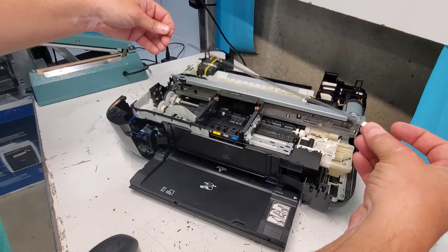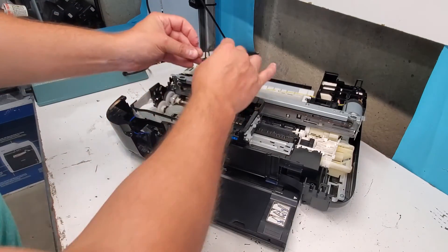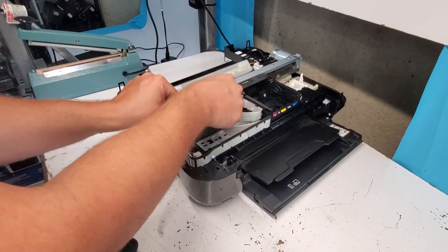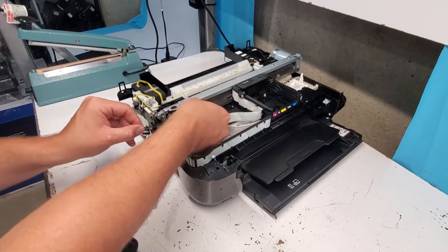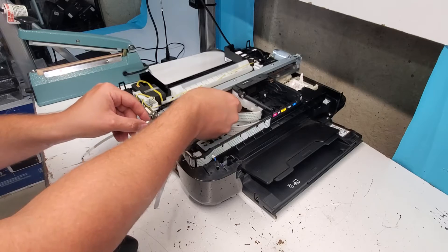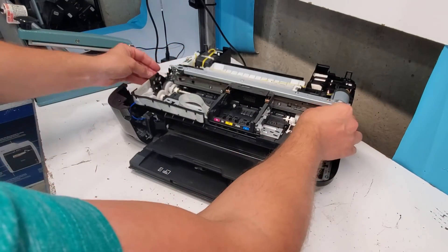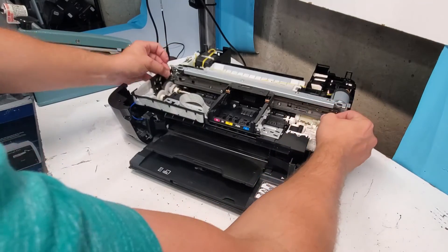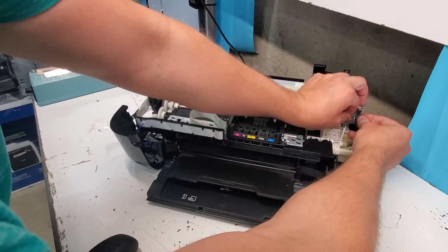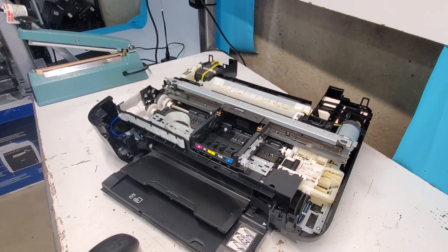The timing strip goes in here. Install it with the digits facing the side you can read from. You're going to feed it through first — it's probably best to feed it through before you fully install the carrier, so you can make sure it's in the proper area. If it's not in between the sensor area where it's supposed to be, it's not going to work — it'll just slam back and forth. Then connect it right here with that spring, and put it on the latch right here.